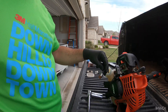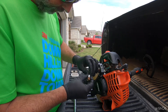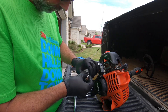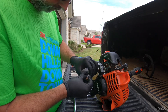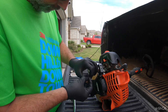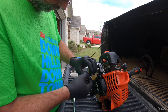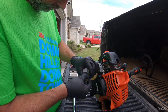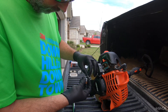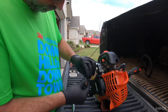The first thing you want to do is slide that clamp down. As long as your fuel lines aren't old they'll still be in really good shape and they won't tear. But if your fuel line starts to break apart, you'll either have to cut that end off completely or replace your entire fuel line. Luckily my fuel lines are still in good shape — no tearing or breaking at all. I've got that clamp down. Now hold the line with one hand and the fuel filter in the other and just slide it right off.